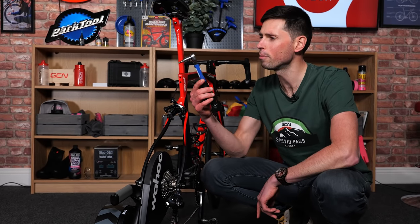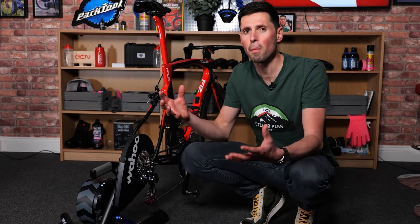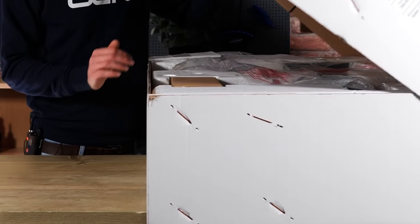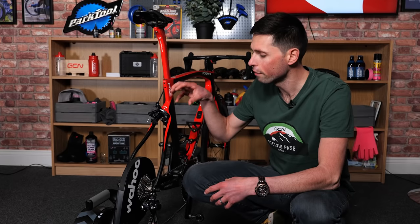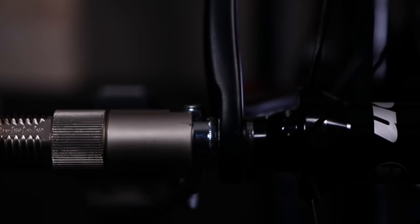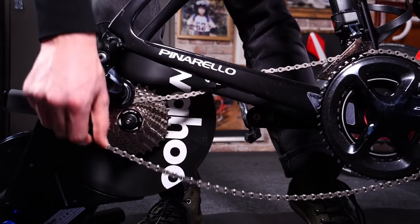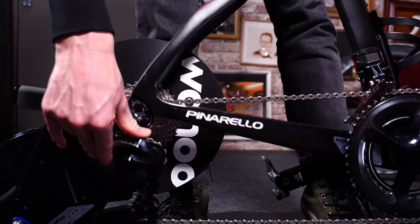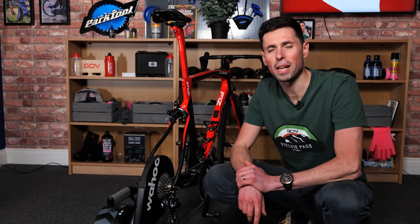This torque wrench is called the TW 5.2. If you've just got yourself a new indoor trainer and need to set it up for the first time, you'll probably find inside the box a selection of different through axles, adapters, and spacers. It's important to make sure you use the correct setup of spacers and axles for your bike — not only with regard to the spacing of the rear hub, because if you don't have it set up correctly you're going to put undue stress through the frame, either by squishing it into a smaller size or having to stretch the frame to fit it over your trainer. When using a through axle system, make sure to use the correct diameter, length, and thread pitch on the through axle, because using the wrong one could make quite a mess of your bike.